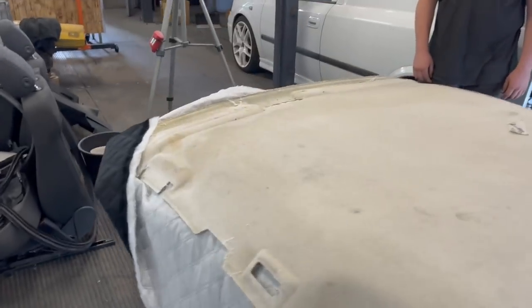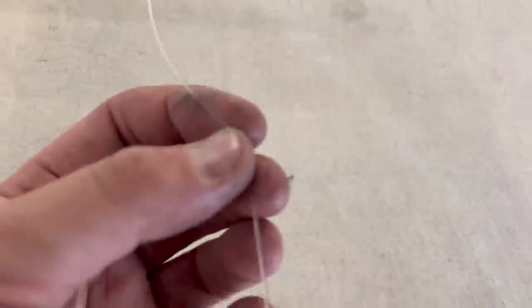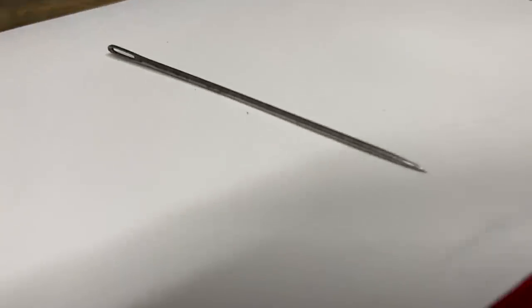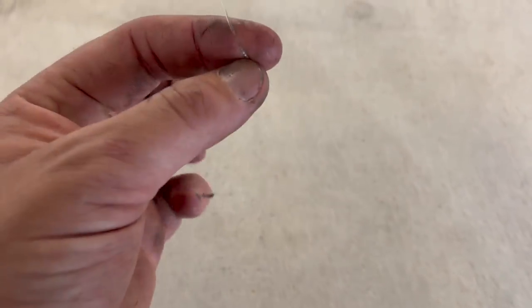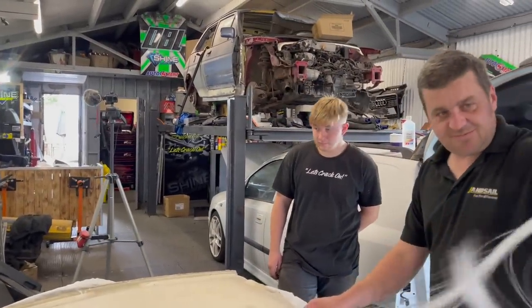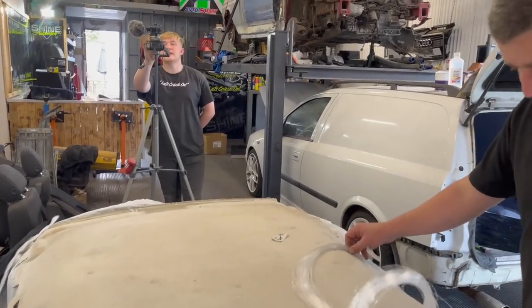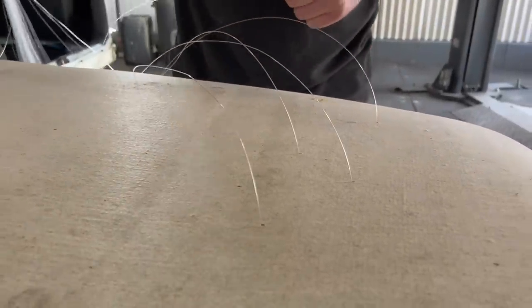The roof lining is done, we've left the excess. It's turned out really well — I'm happy with it. I've never done anything like this before. We've done fur on the Cavalier but that's about it. This was really hard because it's diamond fabric trying to make sure we had it central and it wasn't going to look on the skew. What Sam's going to do now is pierce the fiber optics through with a big upholstery needle, then bang them through — he's got 150 to do.